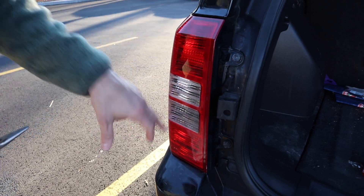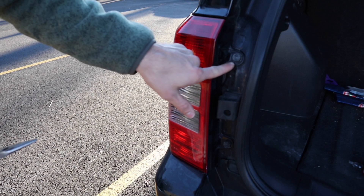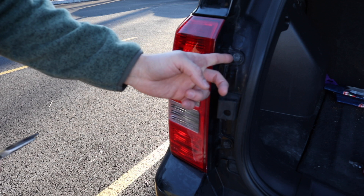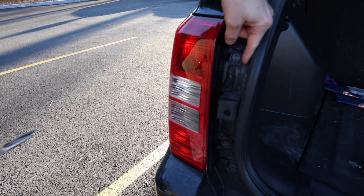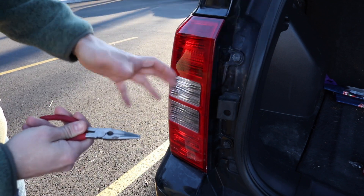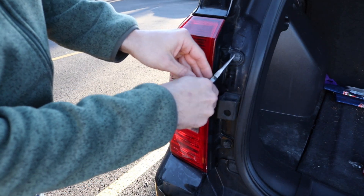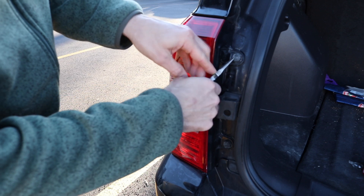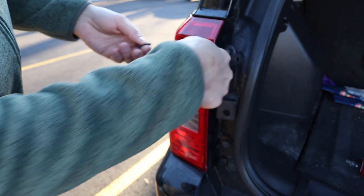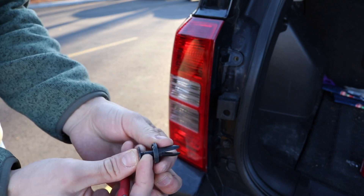On the left-hand side, this is where the brake light is. What you'll find is there's going to be two attachment points with push pins on the inside — one here and one here at the bottom. These are easiest to elevate with a screwdriver where you can kind of pry it up a little bit. Once you pry it up, use pliers to lift it up. I've already got this started just to facilitate doing it on camera. Very carefully, without damaging the plastic, use the pliers to lift this up and pull it out. It's a push pin like this with a piece that pushes in and that's what secures it.